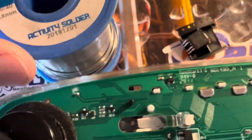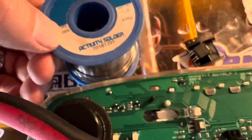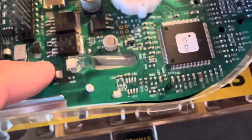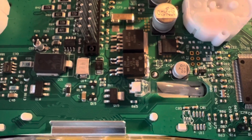I recommend you make sure you're using solder with lead in it. I use 60-40 tin-lead, and tin your iron. If you tin the iron, it'll conduct heat much better and heat it up without burning anything. So that's about it.